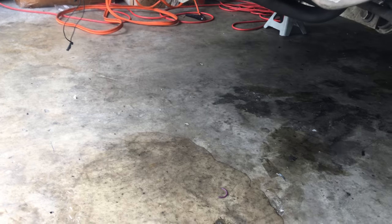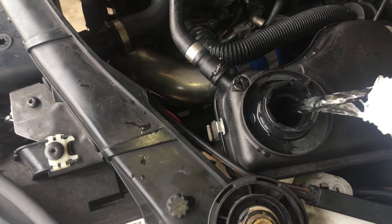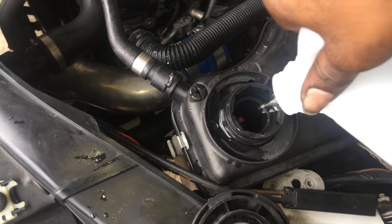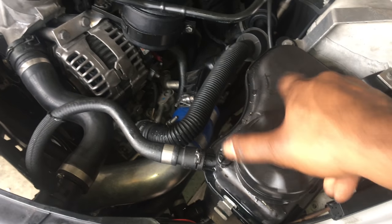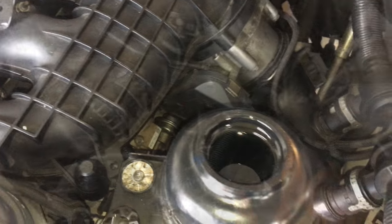Looks dry, nothing's dropping — looks like we're good to go. Adding the BMW coolant now. The mark is up, no leaks — cooling is looking good. Well, not fully taken care of yet, I still need to bleed the system, but I'll do that after I'm done putting the oil in and the power steering fluid in.